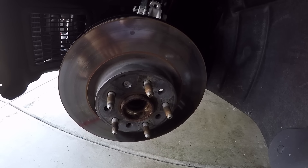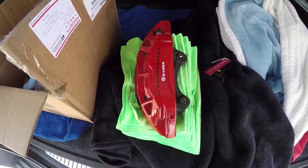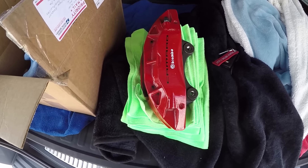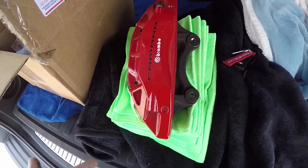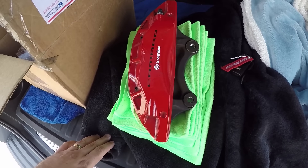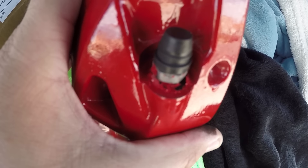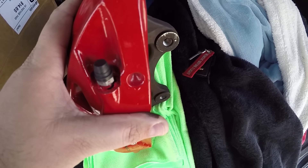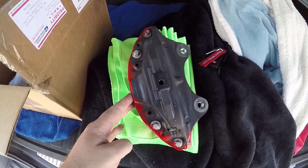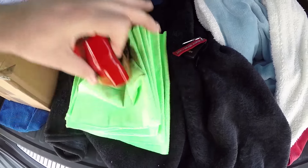I'll show you what they look like now after a year and a half of use. So here are the brakes — these are the stock SS Brembo, the four pots, not the six pots. You can see my beautiful decal lettering; that's not even straight, not perfect. I put it on the best my eyeballs could while it was on the car. The coating is actually holding up pretty nice. You will see there's a couple nicks and scratches in them — that was from me working on my car. The other thing is, you can see up top here when we changed and bled the brake fluid, some of the brake fluid got on the upper edge and it's causing the coating to peel off. And I never coated the backside of them, so I did a super ghetto job. So I'm going to pull these apart, take them down, get them powder coated, and put them back on the car so they'll look all nice and pretty. Let's go down to Precision Powder Coating and see what they have to say.